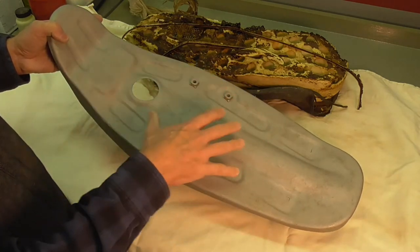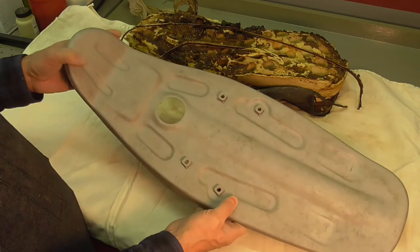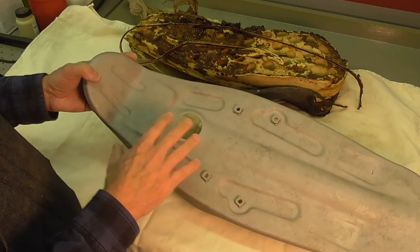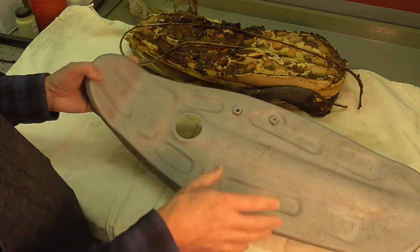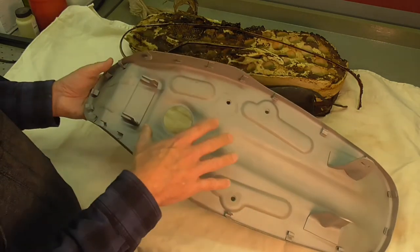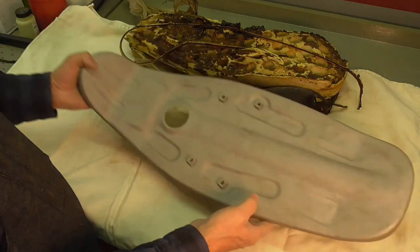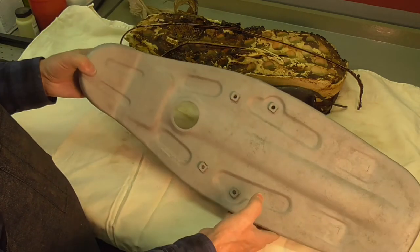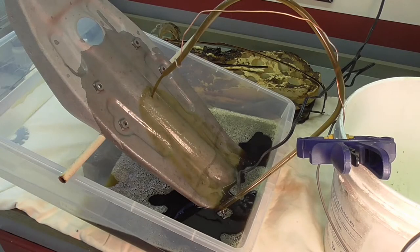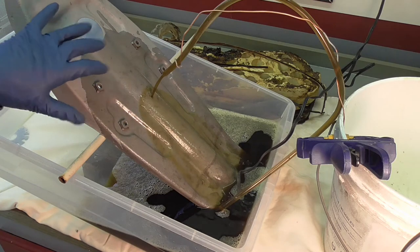So what I'm going to do next is immerse this pan in a plastic tub with rust remover. I've talked about rust removers in the past. I'll probably have to reorient the part a number of times because I don't think I have enough rust remover to do it all at once — that might take a couple of days. After that I'll media blast it once again, and somewhere along the way I'll have to repair these stress cracks. So I'm going to immerse this in a bath of rust remover for a few days and we'll pick it up a little bit later.